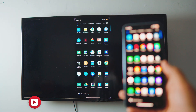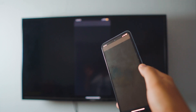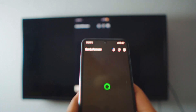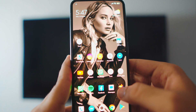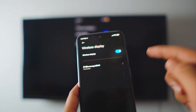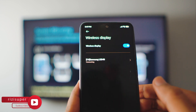If you have a different brand of phone like Samsung, LG, or Motorola, I'll be linking every video in the description box below. You can watch content, play games, listen to music — the audio comes from the TV. To disconnect, head back into Settings, go to Connection and Sharing, then Wireless Display, and simply turn it off — it will automatically disconnect. To reconnect, manually enable screen mirroring on the TV again, then enable the wireless display feature on your phone and click on your TV.